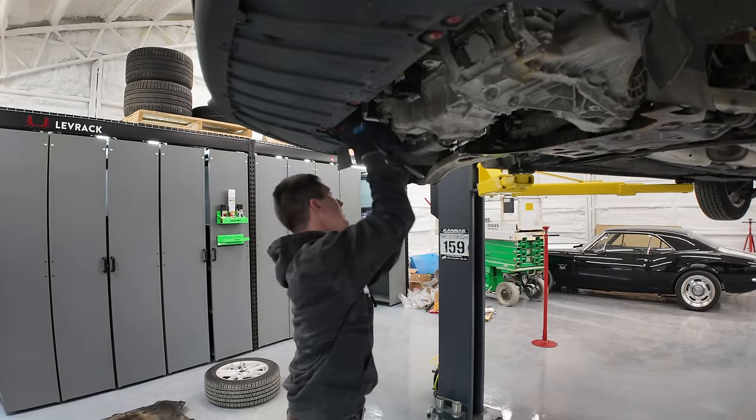So we've got our cordless ratchet to help get these out quickly. All right, here's one. A lot of clutch material in there, that's true. That's pretty nasty right around there. So we'll wipe all that off. It looks like they also put anti-seize on this when they put it back in. Somebody had it out, looked at it once. I don't know. Now for the second clutch actuator.